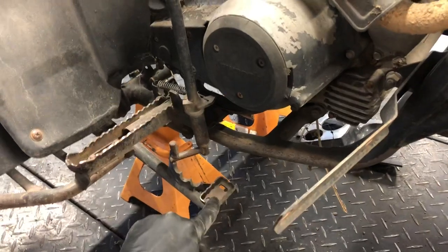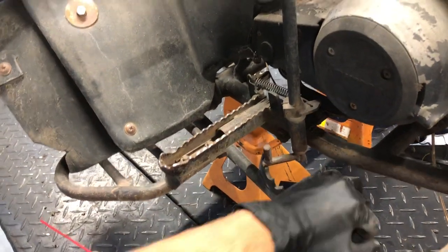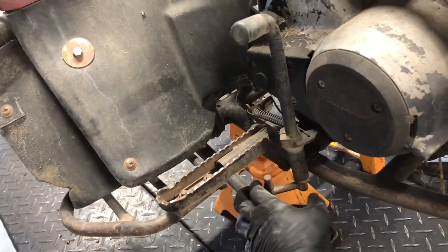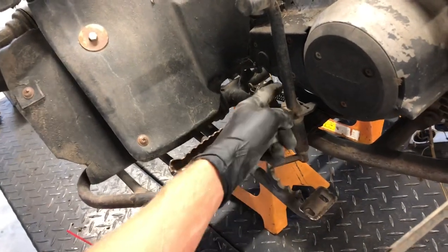We've got your parking brake here. What you do is push down on your brake lever and turn this to the correct position. Right now the park brake is on at the highest position. It's supposed to kick out when you push down on the brake lever here. This lever is spring loaded and it'll kick back.